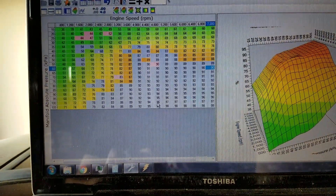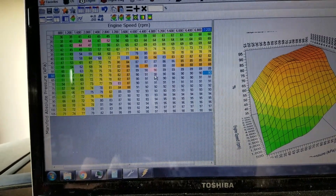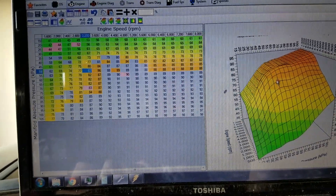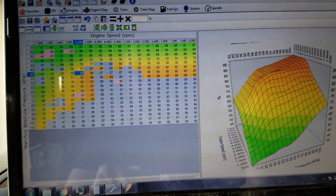You can see here it's definitely a lot smoother up top — took away some of the VE here, but definitely more mid-range fuel definitely needs to be added. So that is definitely a good sign for more airflow and more power.